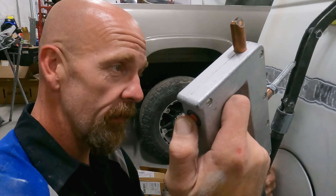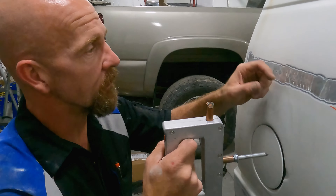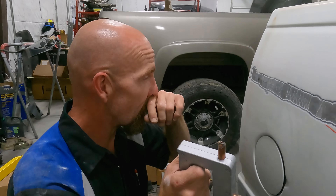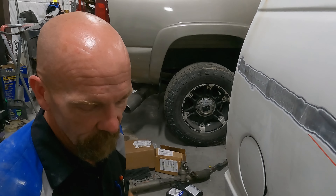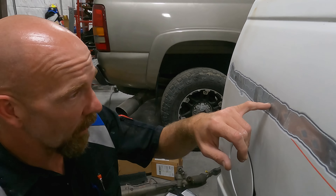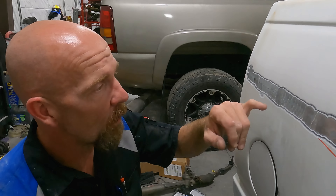This is the stud — a little stud. They changed it from back in the day when you had little pins you'd weld on. You can still use the pin gun, stud gun, whatever you want to call it, but every time you did that it'd leave a dimple twice the size of a normal pencil lead where it'd weld on there. Then you'd cut it off, have to grind it, weaken your metal, sometimes pull holes and have to go through and weld up the holes.